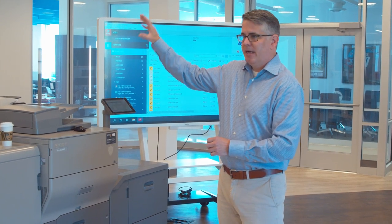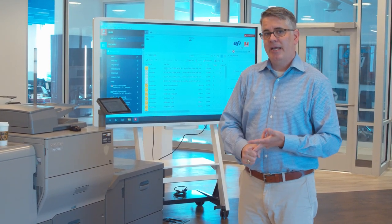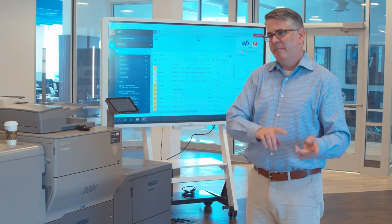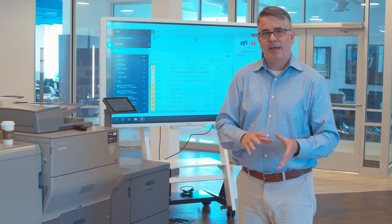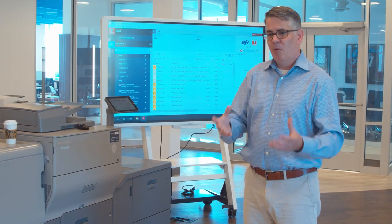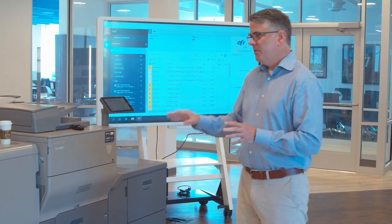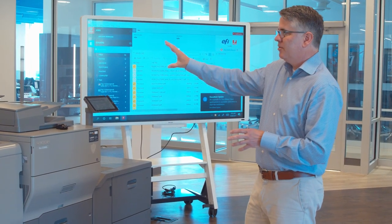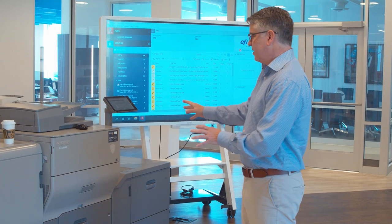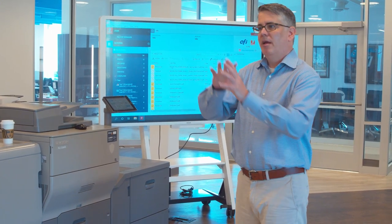That 2400 by 4800 DPI starts here and is carried on the 7200 and 9200. The 5300 is 65 pages a minute; the 5310 is 80 pages a minute. Moving to the 7200, you get 85 to 95 pages a minute and the benefit of adding a fifth color. The 9200 is a much more robust device with much higher monthly volume — 115 to 135 pages a minute in color. The reason you'd move up is paper thickness and monthly expected volume. The 5300 is about 95% as capable as the 7200.